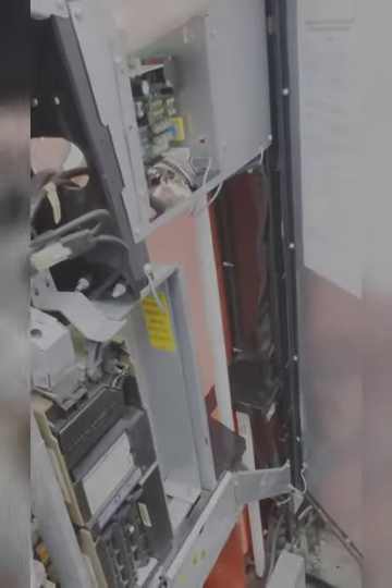When you want to get out of a particular menu, scroll down by pressing buttons one and two until you see RTN on the screen, then press button one to go back to the previous menu. When you're done, press the Mode button on the board and it should take you out. And we're back to the main screen. That's how you do a price change and a motor test on a Dixie Narco 501e.